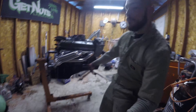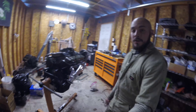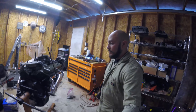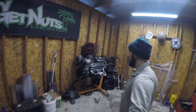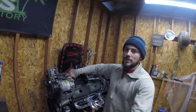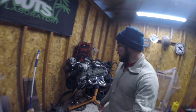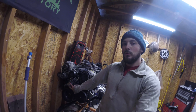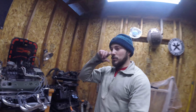I've got the new headers on and the motor mount swap kit for the S10. I've just got to run the wires still — spark plug wires — and then the entire wiring harness, which is going to be a nightmare, but so far it's great. I've got to do the rear main seal, but that's once I pull this up. I'm going to finish everything up, go run to the store real quick. I need to put the pulley on for the water pump, but I can't get the fan off without the serpentine belt or a special tool.